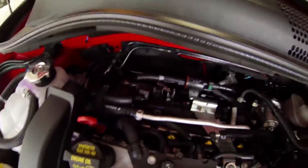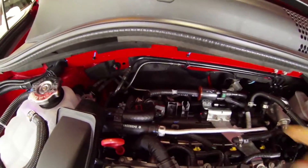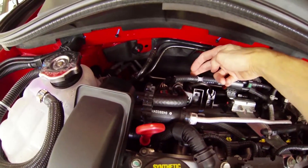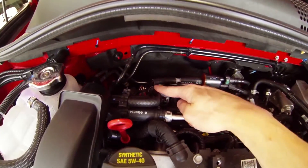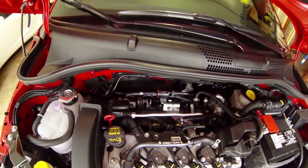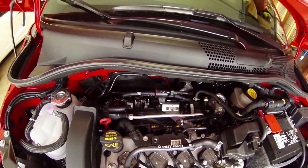And that's what it ends up looking like. Vapors come out of the valve, go through one part of the Y depending on engine operation — check valve here, check valve down here if you can see it. And this gives a much smoother, less restricted flow of evap vapors.